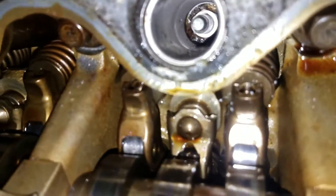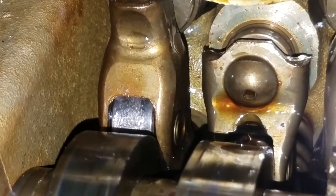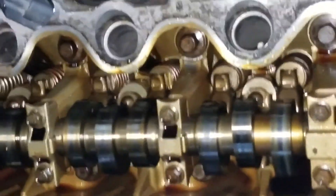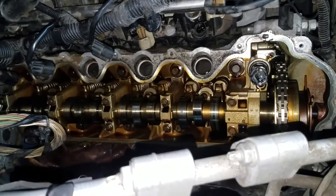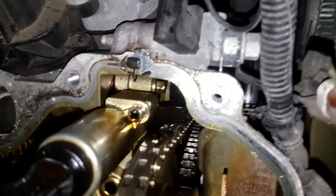So we're going to jump right into this. What's actually happened here is one of our roller rockers has frozen up and it's basically just been sliding on the cam lobe, so it's taken out the cam. Along with this rocker arm, it's going to have to be replaced. We're not actually installing a new phaser on this one, but I'll show you how to install a new cam phaser — you can do it at the same time. So we're going to be doing the cam, the rockers, the lifters, and all this stuff without removing the timing chain or taking the timing chain cover off, which is a big time saver.